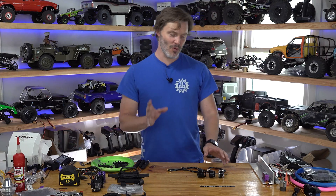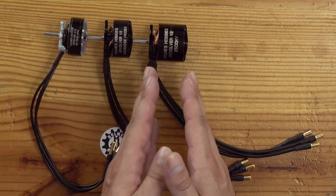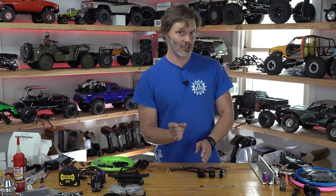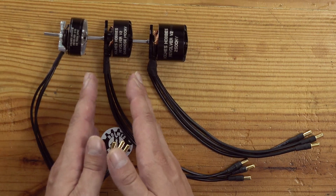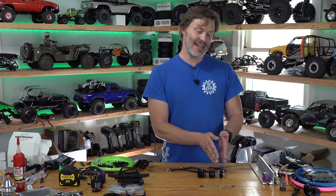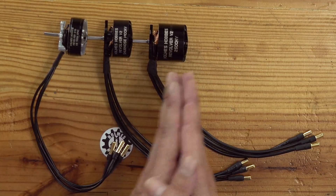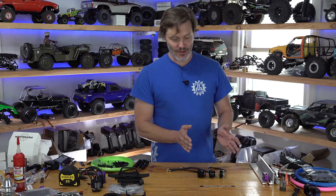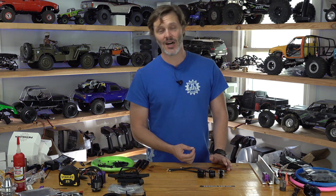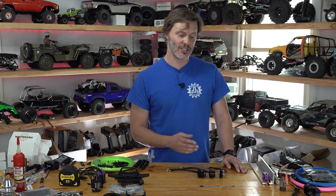Now let's talk about the actual differences between our various models — specifically the difference in sizes. We have our standard 540, which has a 20mm long stator. We have our snub nose 540, which has a 10mm long stator. And then we have our super stubby team spec — we call it SS team spec — which has an 8mm long stator. As you can see, it's big, medium, small in terms of motor size. The reason I went with an 8mm stator on the SS team spec was to get it as light as possible while still being enough motor to perform in the average crawler, especially in a comp scene.